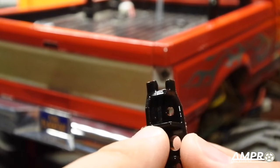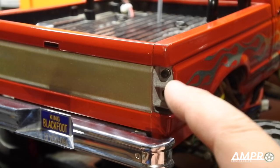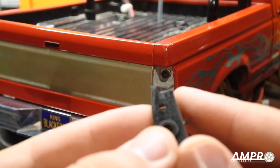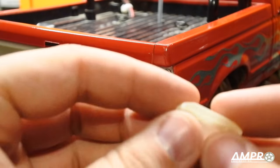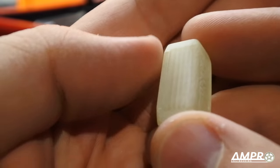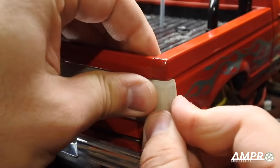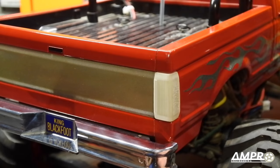The top is a 3mm port, but I've designed these so that if you want to put a larger LED in — in this case a 5mm LED for a brake light — you can simply drill it out to 5mm and put a larger LED in there. When you install this piece, the correct orientation has a little rectangular boss on the inside which aligns right into the bucket. These are super easy to install.